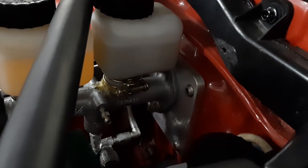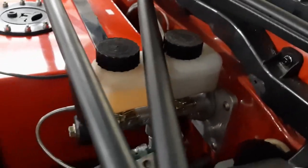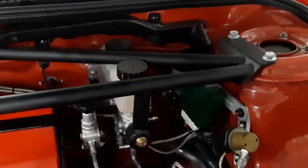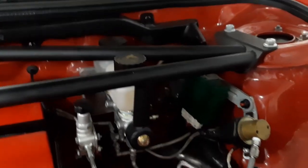I also modified the pedal itself to get a better pedal ratio. In the beginning I couldn't find any other three-quarter bore tandem reservoir cylinders, but since then I realized you can find Nissan and Toyota offerings in this small bore size.